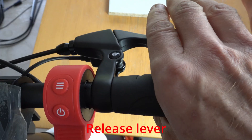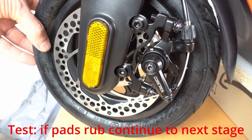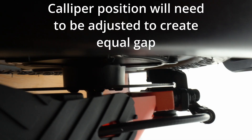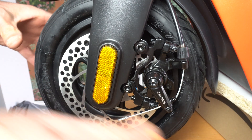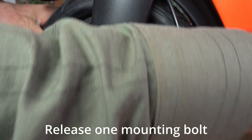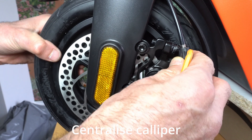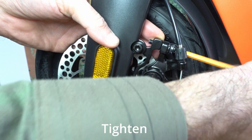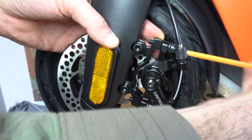Release the brake lever — the calipers should now be centralised. If you spin the wheel and it still scrapes, go on to the next step. To fine-tune the adjustment, release one of the mounting bolts, position the caliper, re-tighten the bolt, and then repeat the process on the other mounting bolt. Once you've finished that process, the caliper should be centralised.